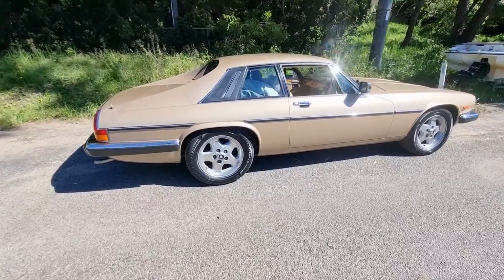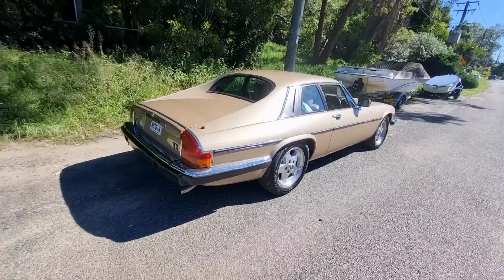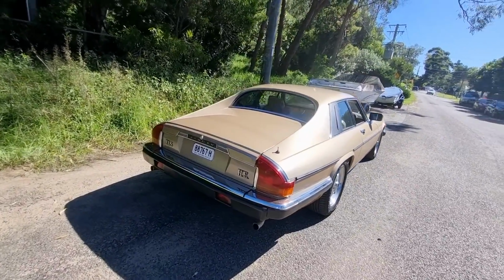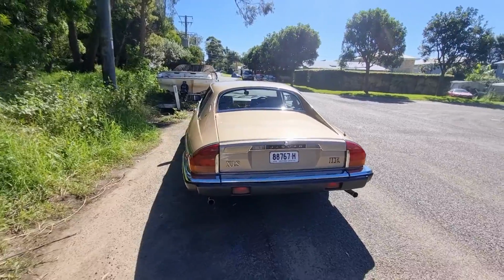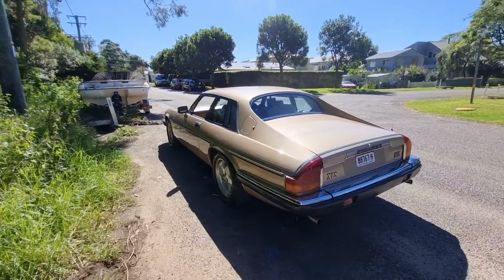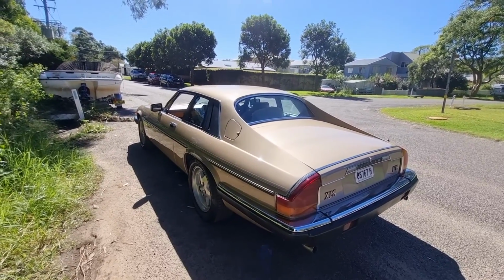The rear shockies, there's 4 of these on the rear. Even replacing new, they're not that expensive, but generally you can find some really good second-hand ones because the same rear suspension cradle goes from 1968 right up to the end of Series 3. And there's been a stack of them that's been wrecked but still have good shockies on them. I generally browse eBay and get some pretty good ones.